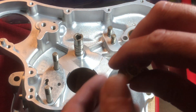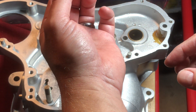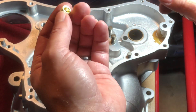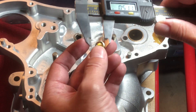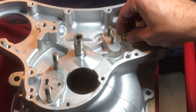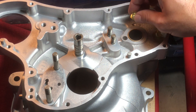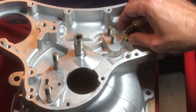I got two choices here. This is an eighth inch national pipe thread plug. If you're not familiar with national pipe threads — and unfortunately I'm becoming very quickly familiar — I'm not quite sure what an eighth means; it certainly is no dimension that I can find here. In considering using this plug, I think it might work, but it's awful close to the cam bushing. I'm very concerned that even if I tap it, it'll come very close to actually breaking into the bushing area.